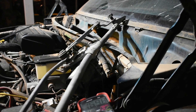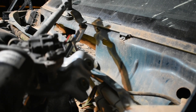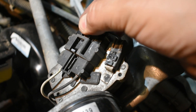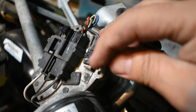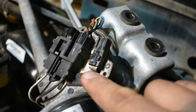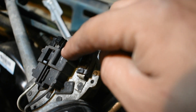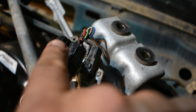When you have access to the motor, you want to look at the connector right here. To remove it, press on top and wiggle until it pops off. Same with this one — press the little clip and it's going to come off. This is the ground for the motor, and then you have four different wires on this connector: one is for high speed and one is for low speed.